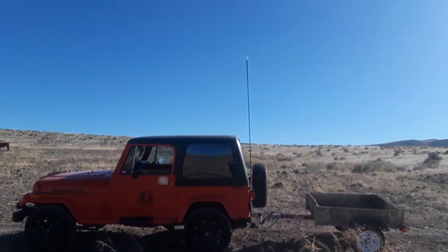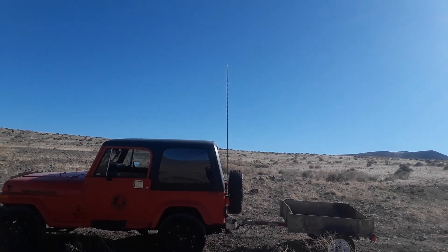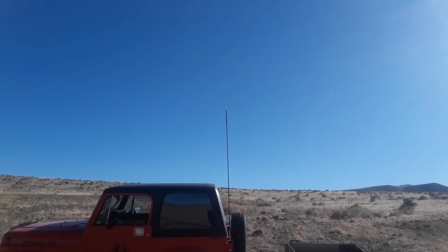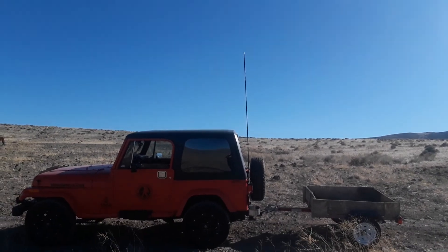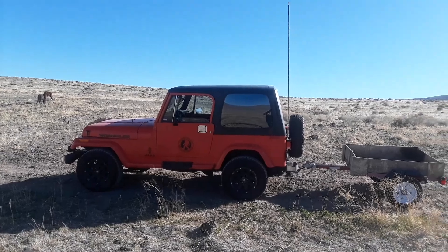So anyways, there's the old YJ with the little trailer behind it — cute little trailer. I did switch the CB antenna: I had a four-foot fire stick on there and switched over to a six-foot skip shooter antenna. Apparently they're supposed to be decent for skip. It definitely has better ears on it and I used the MFJ antenna analyzer to get it all tuned where it needs to be — seems to be doing pretty good.